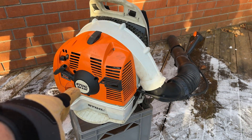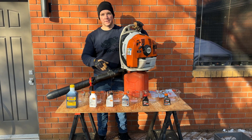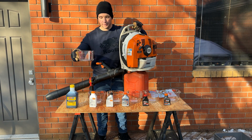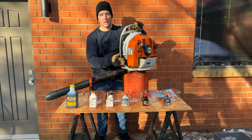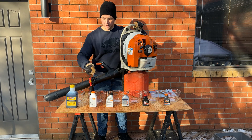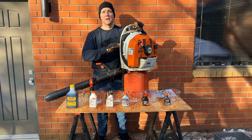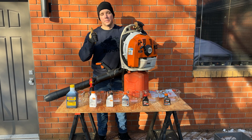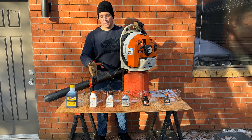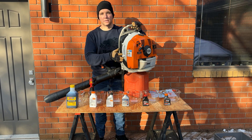I'm going to remove this cover and put the starter back on so I can take accurate measurements of the exhaust. Once I have the fuel and oil mixed up properly, I'm going to empty the leaf blower, run it dry, fill one liter of mixed fuel into the leaf blower, start the engine, and allow it to idle for five minutes. At the five-minute mark I'm going to get a temperature reading from the exhaust. The reason I chose five minutes is because that is more than enough time to bring the exhaust temperature up to a consistent level where the cooling system as well as the oil are doing their job.